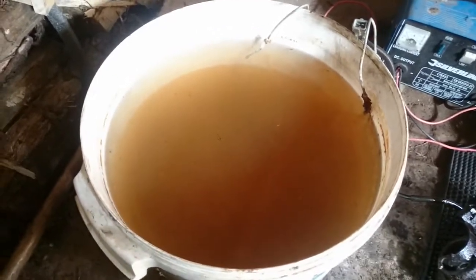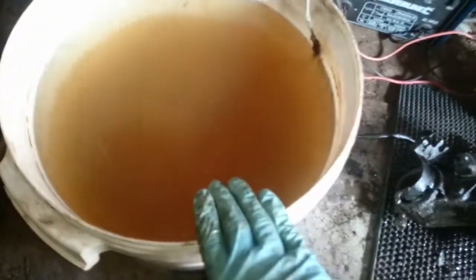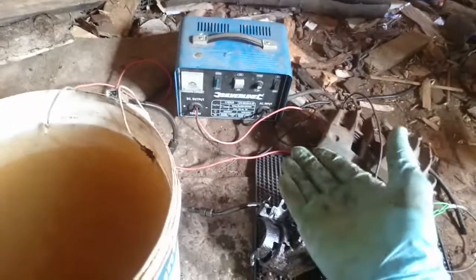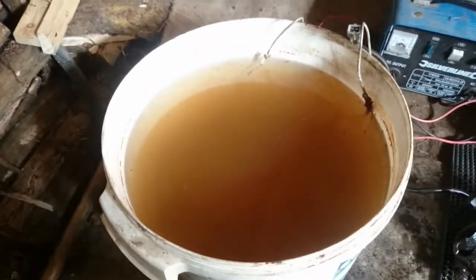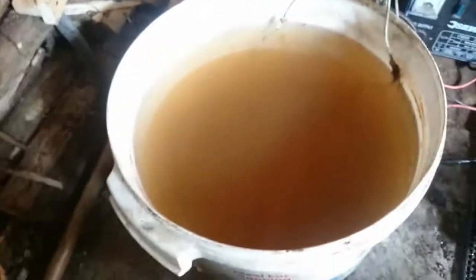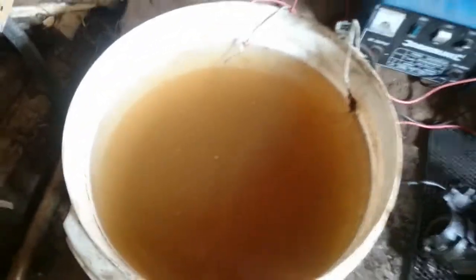Paul, whose username is Cully on the 306 OC - looking lovely in there - recommends about 15 litres of water to half a bag of soda crystals, which is half a kilo. I ended up using about 18 and a half litres of water to one bag, and I used 24 volts, but that could be because the charger is a bit iffy. I got the same results as he did with 24 volts as he did with 12, so I'm assuming that charger isn't putting out much current. But you saw the level of dross you want on the top and the little bit of fizzing you want to see, and after about 12 hours you're left with something that will just clean up lovely. Then after a quick wipe down, that's what you have. Full credit to Cully - Paul is his name - and I will put a link down below to the 306 Owners Club guide. There are no pictures unfortunately, but then there's this video to help you along.